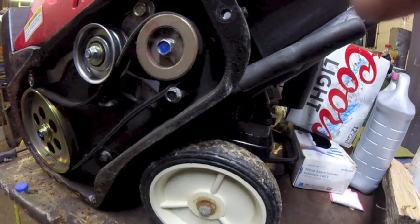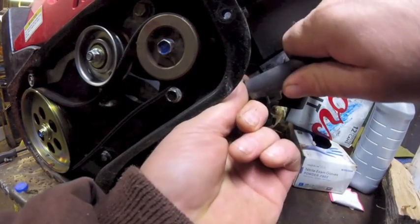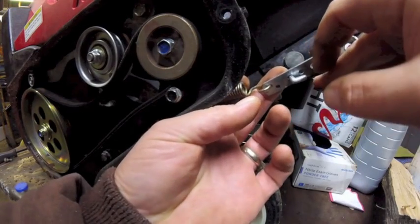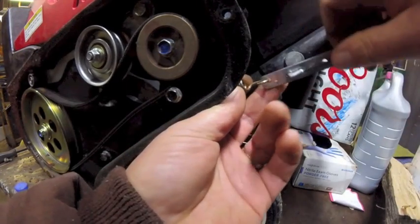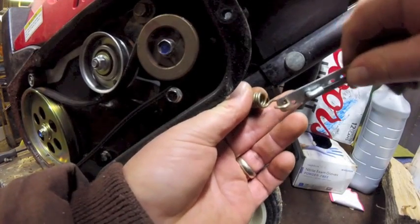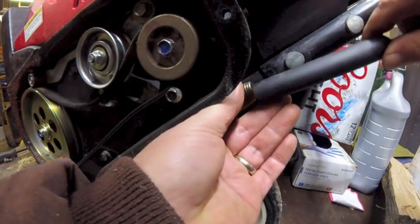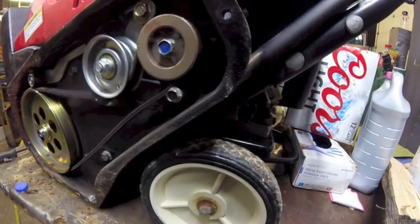So while you're down in here, you want to check the other end of the cable. You got to peel back this cover here. Check the bend. Yeah. This Z-bend is in good shape too. Plate's in good shape, and look at the end of the spring. Hook looks good. Cover it back up. And just check the tension. Peel back the cable.